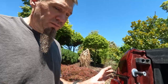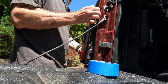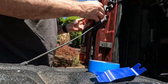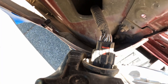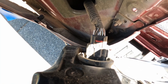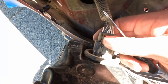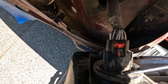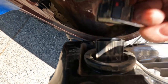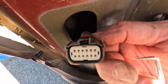To remove the tail light you need to pull it straight back. Once you get it out, there'll be a connector — you can either hang the tail light out of the way or disconnect it by popping the red tab out of the way. Once that red tab is undone, put a little clip tool underneath to lift the tab up and pop it right out.